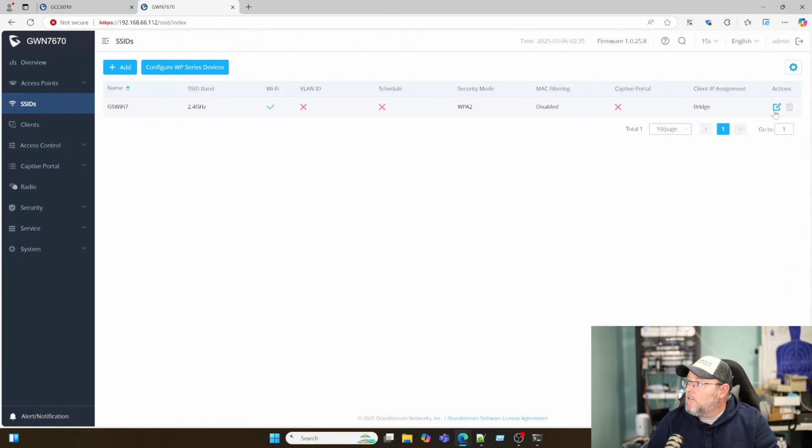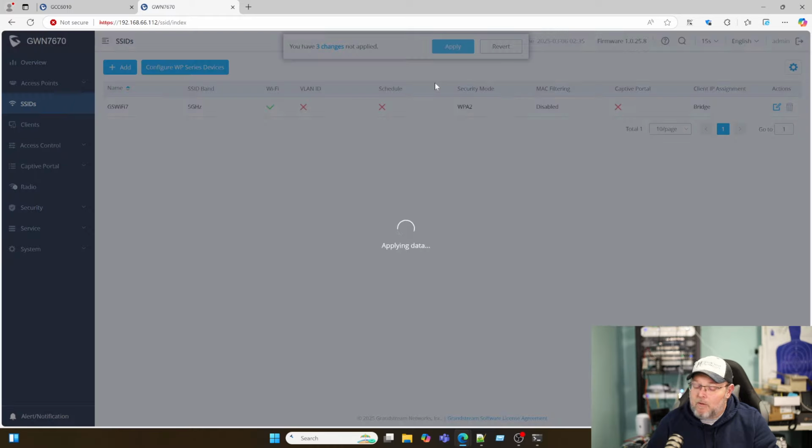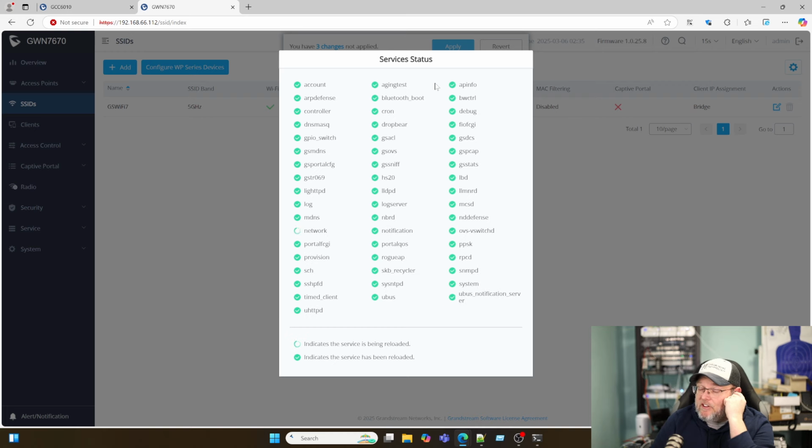So now let's hop back over here, and we are going to go to the SSIDs, and we are going to edit this, and make this 5 gigahertz only, and we'll apply that. And then as soon as it applies it and kicks us, we'll reconnect and do another. Oh, the other thing I could do as soon as this comes up is look at what our channel bandwidth is. I just now thought of that. Because the wider your channels, the more you're going to interfere and not be a good neighbor, but the faster your throughput's going to be, but also the closer to the access point you're going to have to be. So there are some nuances to that.